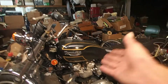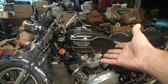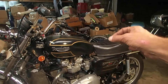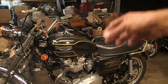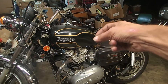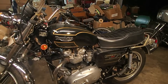I had a problem earlier where it wouldn't start and I realized I just wasn't getting spark — nothing wrong with the carbs at all. What happened was when I replaced the coils, I put new leads on the wires to plug onto the coils, and they seemed fine at the time but they just weren't snug enough, so they kept rattling themselves off the coil and I wasn't getting any spark. I went in with my electrical pliers and pinched them down a little bit, and now they should hold snug.